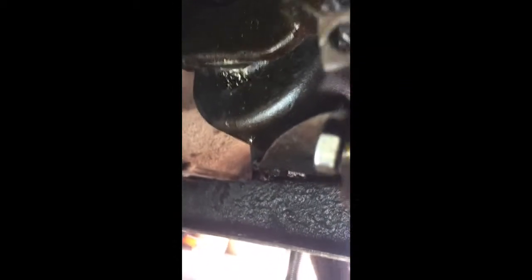While trying to use my wedges to pry the transmission from the bell housing, I was unable to pull it more than maybe a quarter inch or so, and then when I got underneath the car I realized there's a bracket that's attached to the underside of the transmission. I don't know if you can see it. It's either the head of the bolt or maybe the nut that holds this bracket for the slave cylinder,